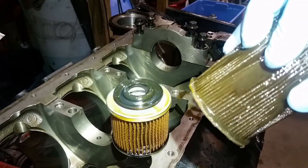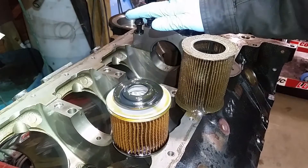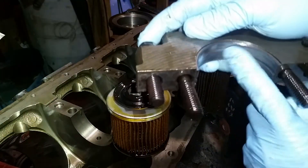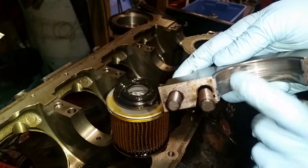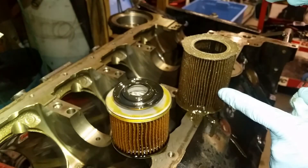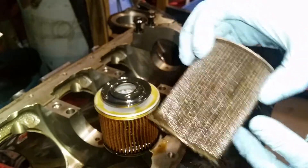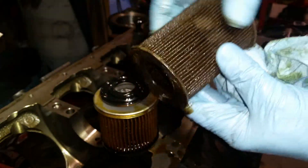If you're wondering what makes an oil filter get that metallic goo in it, it's usually a sign that you have some sort of mechanical failure. With this particular engine the failure point was the main bearings. If I pop these out, you can see the bearing surface — it's removable, there's a top and a bottom. See these shiny spots? That is where the crankshaft smacked into the bottom of this main cap. The metal debris worn off of this and the crankshaft ultimately ends up in the filter. This filter came out of a clean running engine and you can really see the difference — kept up on oil changes, very clean filter, could have got a lot of life out of that. Whereas this one is just disgusting, just tons of metal debris and nastiness.